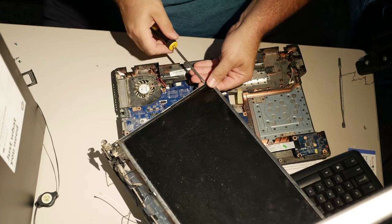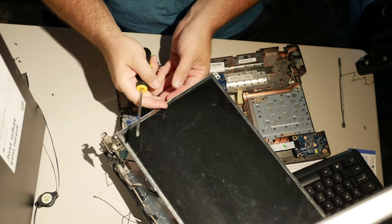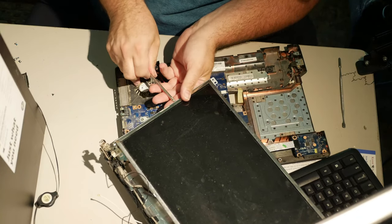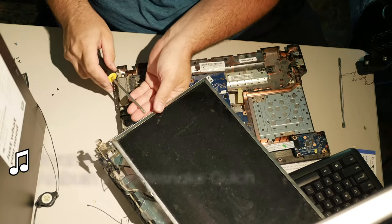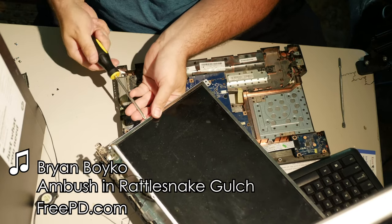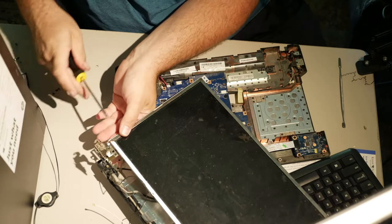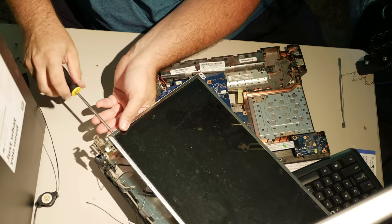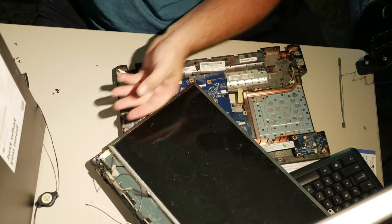Yeah. That's bad. So I'm gonna take this hinge off, and what I'm probably going to have to do, since I'm lucky actually to have that come off as one big chunk of plastic and not a bunch of little anchors, I'm gonna see if I can get the hinge to sit down by itself, and in doing so, if I can get the hinge to just stand up in the base by itself, I won't have to have this screen hanging off of everything or do the epoxy work in two stages, one for the screen, one for the base to be attached. The less weight you can have dangling off of an epoxy joint you're trying to get to set, the better.